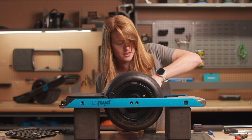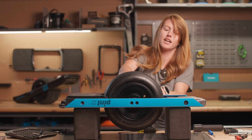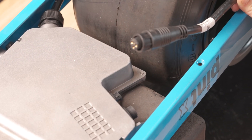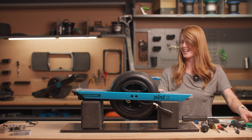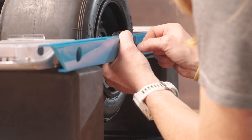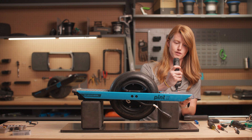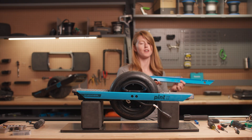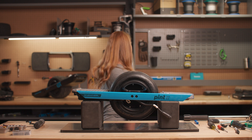This motor cable is a little tricky — you're going to want to get it out from behind the rail, then unscrew the clip and pull it straight back. Next we're going to take out these axle bolts so we can take the rail off. Now we'll remove these four screws. The axle block is going to fall out with your rail, so just keep those together.